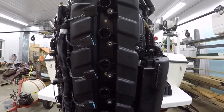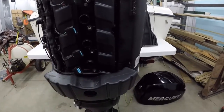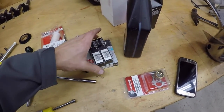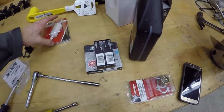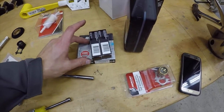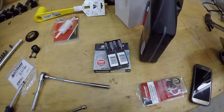Now we're going to pull each of the plugs. I'm going to check my new plugs for gap — I'll use some feeler gauges to make sure the gap is correct on those. You can see the coils over there. Take a look at the old plugs and make sure you don't see anything wonky with them. Just always good to inspect. As I said, as you're already here, I'm always looking for any wires that might be showing signs of wear or cracking, making sure I'm not seeing anything that looks out of place or stressed.